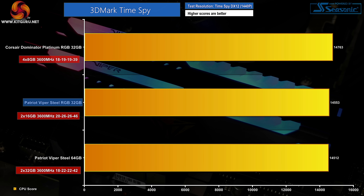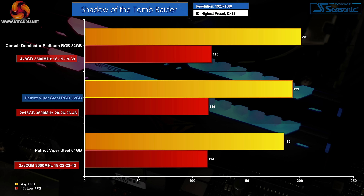The effects of the AMD test system — memory channels, ranking, and related factors — could be influencing this performance trend. It's more of the same in gaming-related tasks: the Viper Steel RGB memory is marginally quicker than the technically tighter 64GB SpecTek-equipped kit, but Corsair's more expensive modules are tough to match. In real-world gaming that translates into higher FPS for the Corsair Micron-based kit, though the Hynix ICs on the Viper Steel RGB do a reasonable job and outperform the SpecTek-based 64GB Viper Steel kit on our AM4 platform.